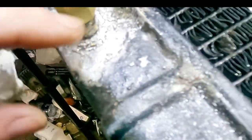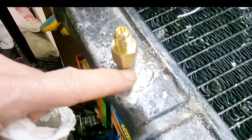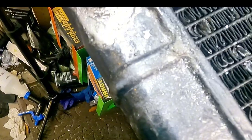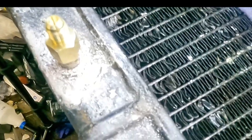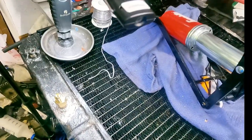The only one left now is to do up there. We gotta turn everything around and fill that in. So basically, take your time and just let it flow. My soldering iron is at the bottom end of being able to do this at 500 degrees. You'd probably be better off finding a very high watt soldering iron, which I'm probably going to get myself. I thought that one would be enough just to make it flow, but it was just a lot of persistence, getting it to flow into the crevasses, as they say. Okay, so we'll do the top side.